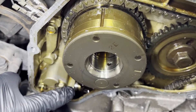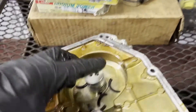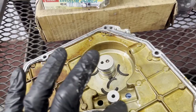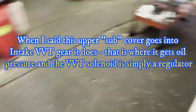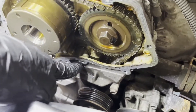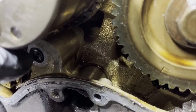When the chain skipped and we lost that upper chain guide, this thing popped out — another major, major problem. This upper cover houses your oil solenoid. The oil solenoid slips in this hole. All the oil pressure has to be directed from the oil pump, through the timing gear — the VVT gear — into this housing. The oil solenoid sits in this cavity and controls the pressure by throttling back and forth, and that's your return hole. There is an O-ring you don't want to lose in the block section where the rearward timing covers. This is the main body timing cover; that's just a front subcover for the VVT solenoid. This O-ring down here — you don't want to lose that, you want to replace it.